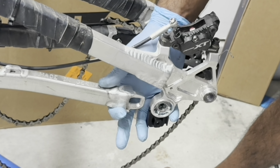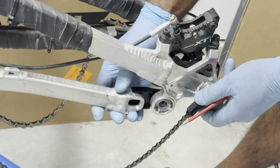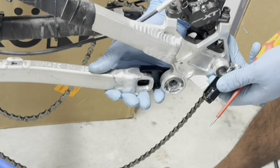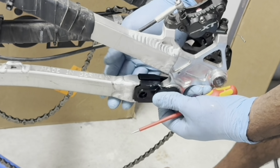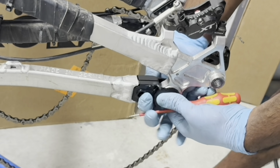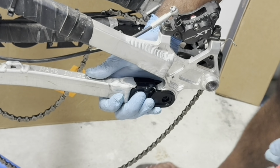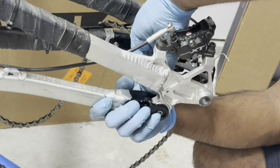You have to move the entire swing arm into position. It's easy now because the other side is fixed up. Otherwise you want to really align it, or else it won't fit in properly. Once you align these two, they pretty much lock up really well, at which point you can start putting the bolts in — and once you do one side, the other side is much easier.